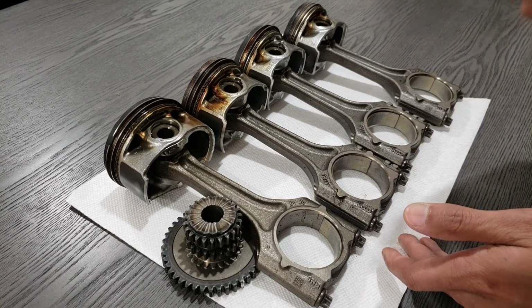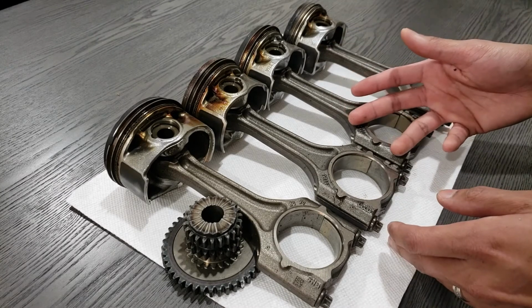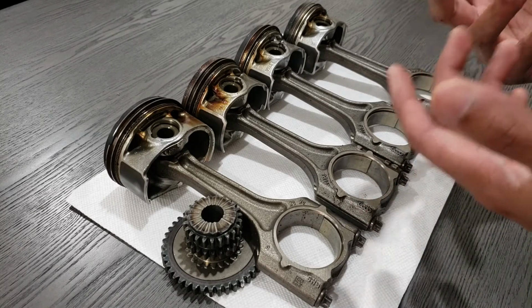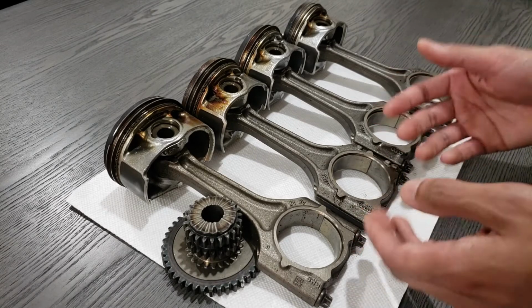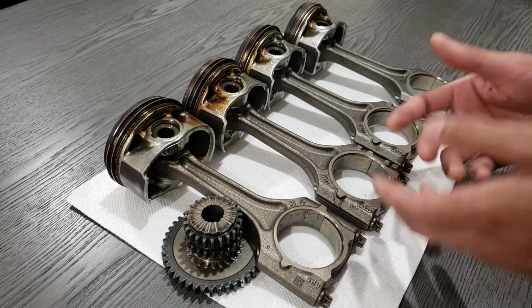So basically my fuel system could not flow as much volume as needed to have the correct air-fuel ratio, which ended up with the air-fuel mixture being extremely lean, and when it's lean it becomes extremely hot. So I think that therein was where my problem lied. It's out of sheer stupidity, just my own ignorance, and I got to pay the price for it.